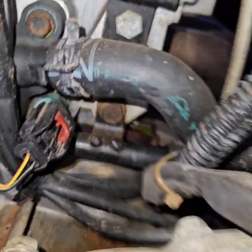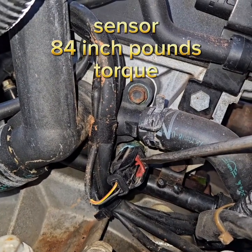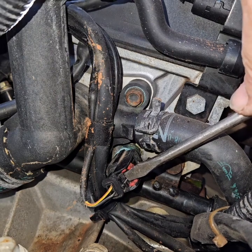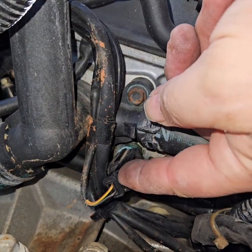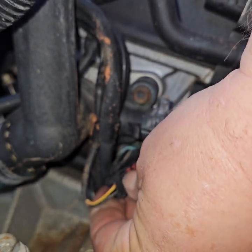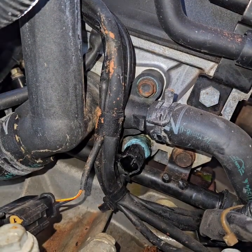The temperature sensor had been leaking — it would have been that right there that I needed to disconnect and replace. The way you get this sensor wire off: gently work this back, then push on this black tab right here because it's freed up now. Get in here and push on this tab and just work this off. We need to really drain the antifreeze in this first.